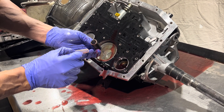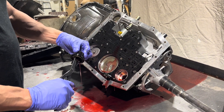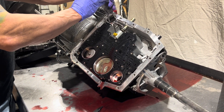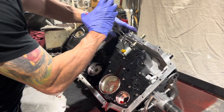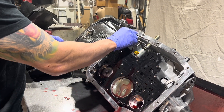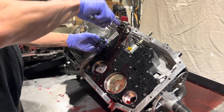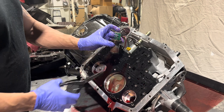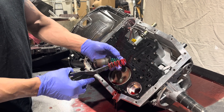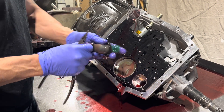You can see there's an inner spring added to the two-three accumulator. Taking out the two-three accumulator now, and this is the one-two accumulator. This looks like an aftermarket spring they have in here - one large spring on top and these red ones both look like aftermarket springs. We've got a little Christmas-themed green and red springs in here.